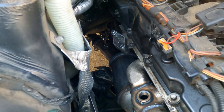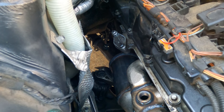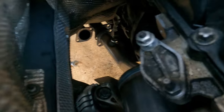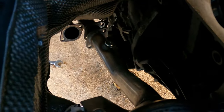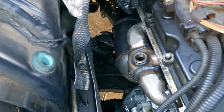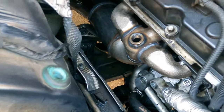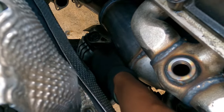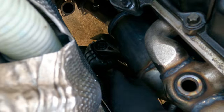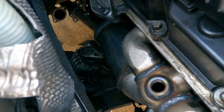I'm going to put the gaskets on. Do you want to put the O2 sensors on the bottom? We're putting one through the top. This first one we're going to put down through the top. That bracket was getting hung up on the motor mount right here when we were trying to take the old one out from the top — that's why we had to jack the car up and pull it out through the bottom because of that bracket.